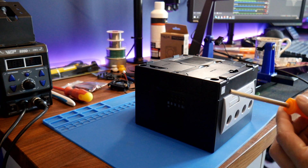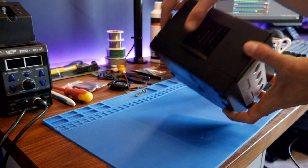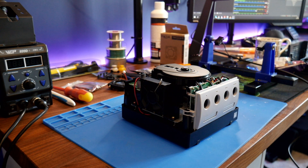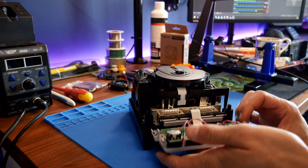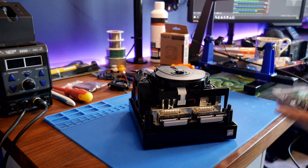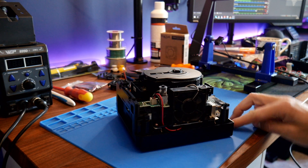I've already undone the screws as it was open earlier. We can just flip it back over and the front piece will just lift away. Let's pull this front piece out and get it out of the way — that just unclips. Then we pull this ribbon cable up and move that out of the way as well. Coming around the side, this is our actual fan piece here.